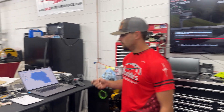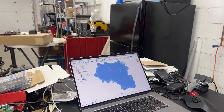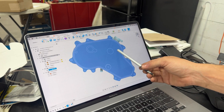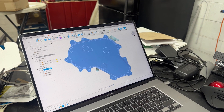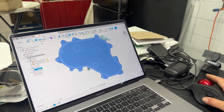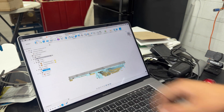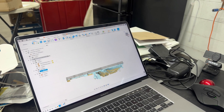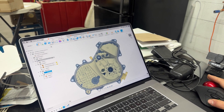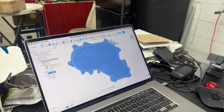From the 3D scanner, we move over here into our 3D modeling software. You can see here we're back onto the timing cover. Eventually we will include a spot here for your cam sensor — could be moved depending on your ECU, and we'll take suggestions on that. We basically took a 3D scan of our cam cover, put it into the software, extruded from it, and we're going to use that to make a billet cover for your aftermarket ECU.